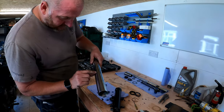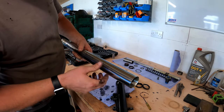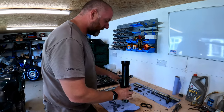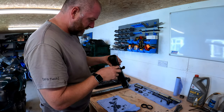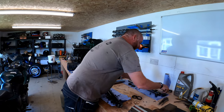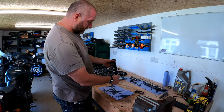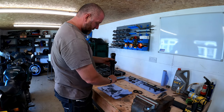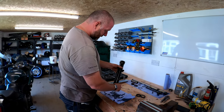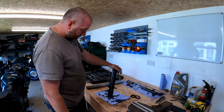As you can see, that's quite nasty and gammy - that is what held in the oil seal. Now we need to try and separate them by basically banging these together. What I'm going to do is whack the underside of this stanchion against the underside of the seal to drive the seal out - it'll probably come out with the bush. There are two bushes inside - one inside here and one on the end of the stanchion - and they'll basically bang together and pull the seal out. There we go. There's the bush on the stanchion and the one at the lower fork, and there is the oil seal - pretty knackered. There's the stanchion with quite a lot of pitting in the chrome. You can get them re-chromed, but the cost of re-chroming is probably the same as a new pair of stanchions anyway. That is the lower fork - it will be going off with the frame.